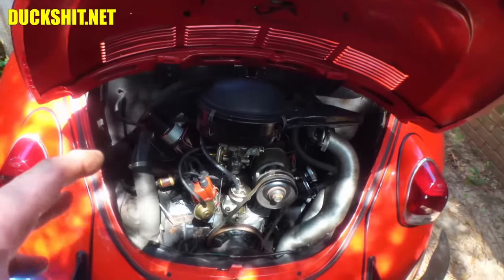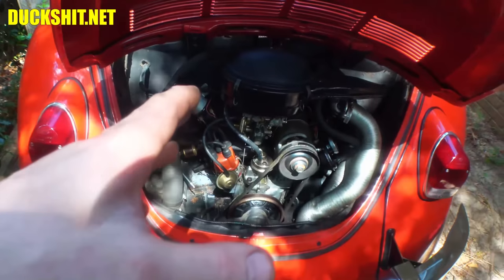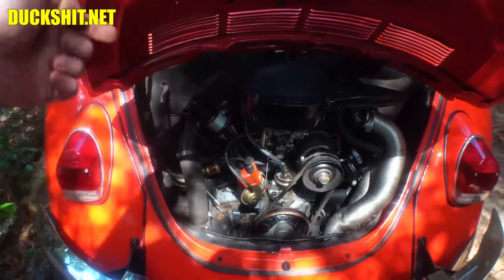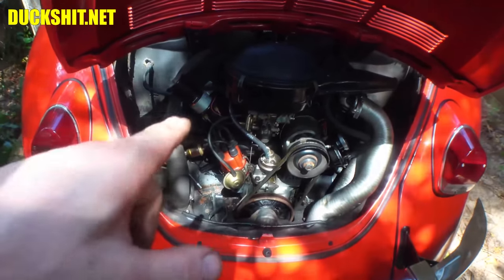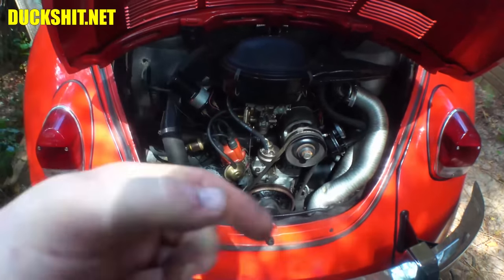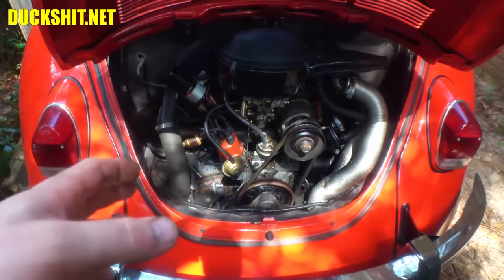If I have a problem feeding this cable through and it does not come out where I'm pushing it through here, and it binds up somewhere, I'm going to have to get up underneath the car, find where it's at, and then force it through. But if it does have the Bowden tube like it's supposed to, if I push the new cable through with the old cable still in line, generally they will go through together, and it shouldn't be as big of a problem. This is something a two-person operation would work for.